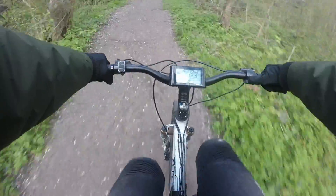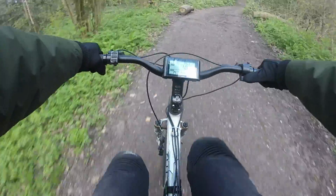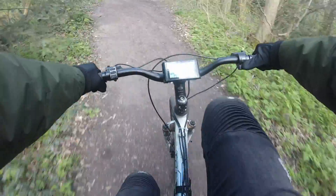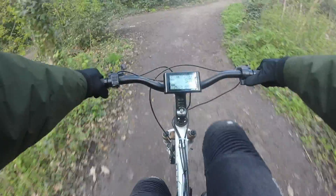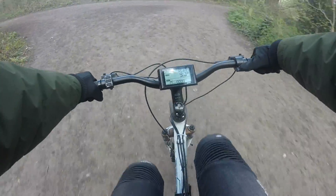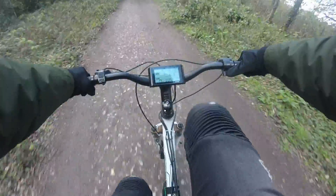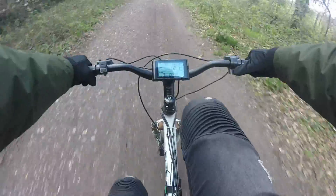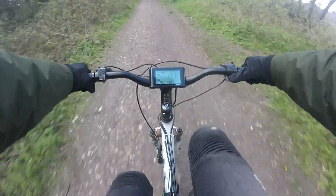My plans to begin with for this bike are to try and source a decent battery that's going to stay on the bike all the time - i.e. build my own 18650 pack, maybe a 21700 pack. After that, the speed controller is going to get modified: I'm going to modify the rails which supply the voltage, beef them up, and then I'm not too sure if I'm going to look at upgrading the MOSFETs just yet - I might, I might not.